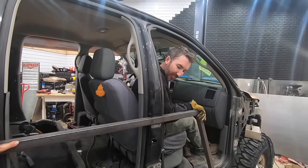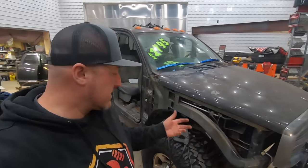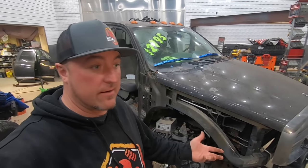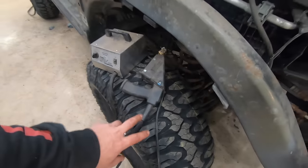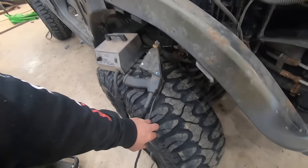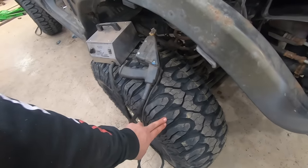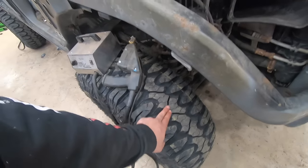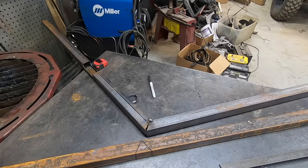Uh-huh. Perfect. So you've seen us groove tires before. We've grooved swampers, we've grooved all kinds of things. In this case, we are going to groove this because we are in the east and you have to have huge spacing for the mud to clear out. So this is a trick I used to do with the old super swampers with the three-stage lug, taking out this inner lug completely and then maybe taking out the insides of here, or maybe just chasing that, maybe is what I'll do, and just widen these out. What do you guys think? That's my thought. We'll find out.